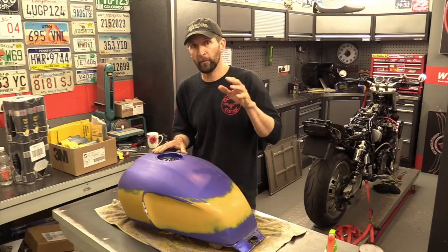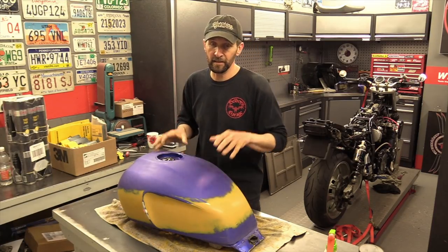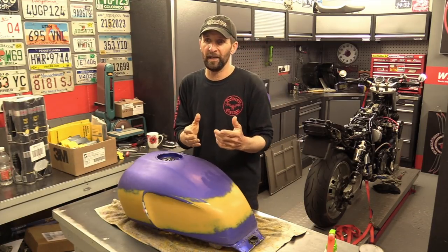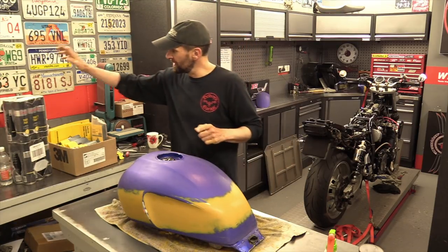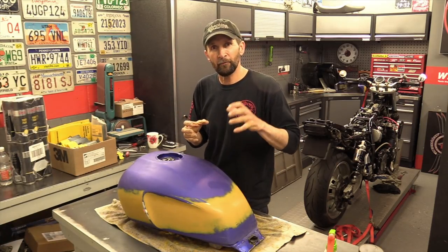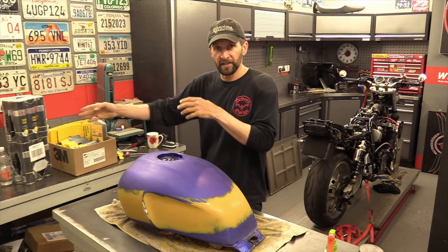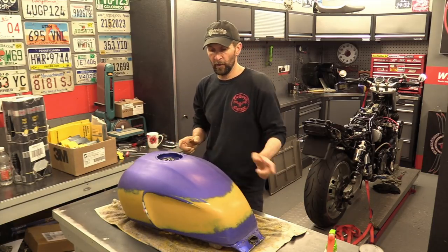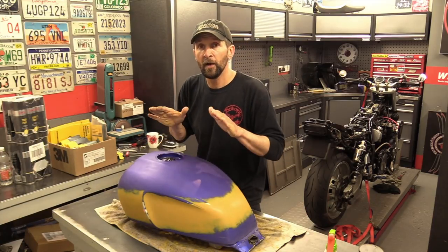And that's one other thing. Mackie said to me, rub down with 800 grit, 600 to 800 grit before paint. But in this instance, for this particular one, I've rubbed down with 400. 400's a bit coarser than I might have rubbed down with normally. It doesn't need to be 400 and it can leave lines. However, I'm using this tough paint. Now this tough paint is a chip resistant substance. It doesn't dry rock hard. It's kind of got a flexibility to it and it needs a good key. It does say so on the tin. I'm just following the instructions on the tin. So ultimately I've gone with a 400, then I can put a guide coat over the top, nice and solid all the way over, and then I'll be flattening that back with an 800.